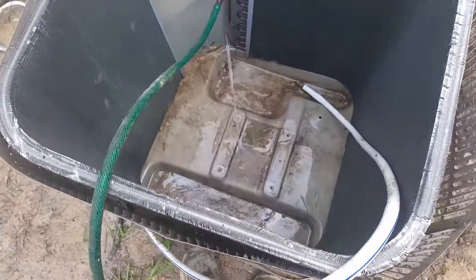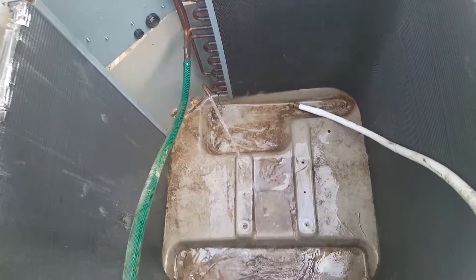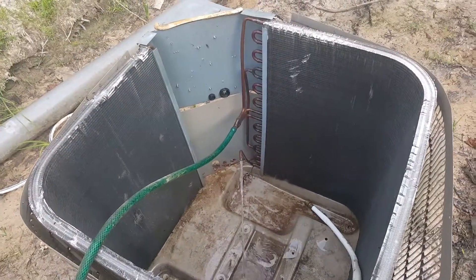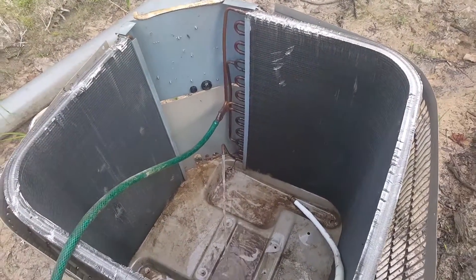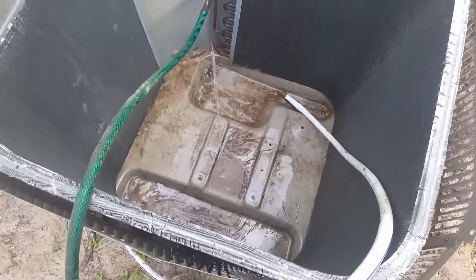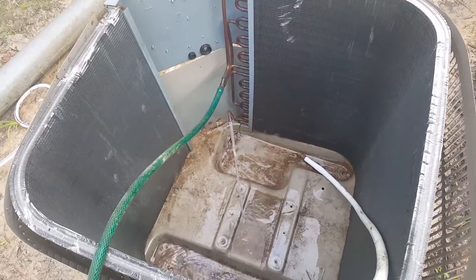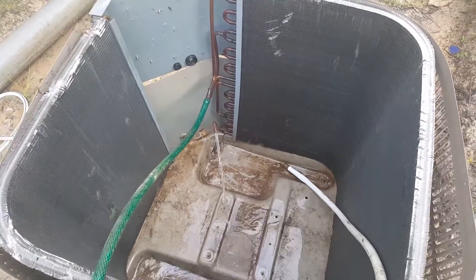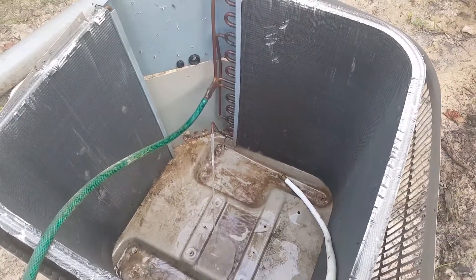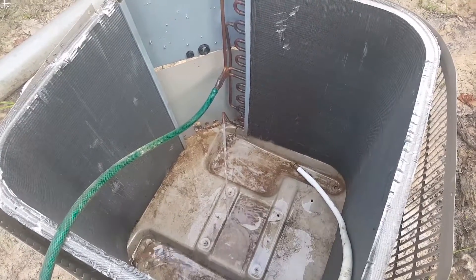She's clean and gutted out. Circulating some water through — just to see what kind of flow it's got. You probably don't even need that much flow; that radiator takes like half a gallon a minute. You've got cold water in and hot water out, with hot air out. But if that ain't enough and you really want to put some hurt on some hot air, you can run it through a coil and some ice to really cool that water down first. The key is: the bigger the temperature difference between the hot air and the cool water, the more heat it pulls out. It's got to be better than nothing.